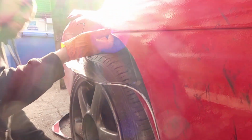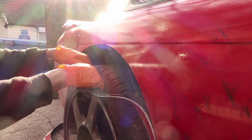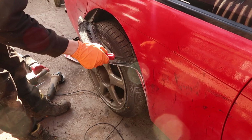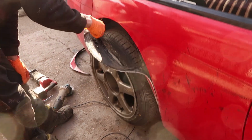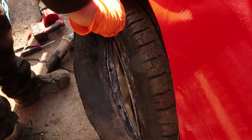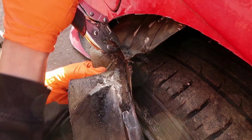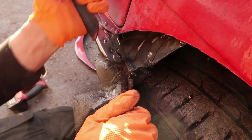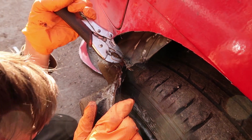Handily though, look, they've actually spotted it pretty much where I need it, this one that's up it. Just quite handy. They've rolled the arch there, they've cut it and then rolled it and then stuck it all. Which has caused me problems before, where obviously where they've cut it, like here, it's just been a random tab which I've then had to try and roll back just on the car, which is never efficient at all. God, you want that sealer in there, it's crazy.